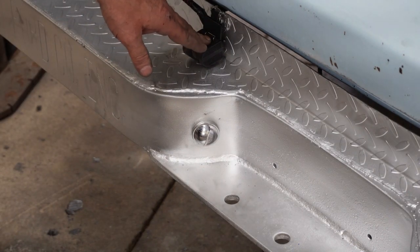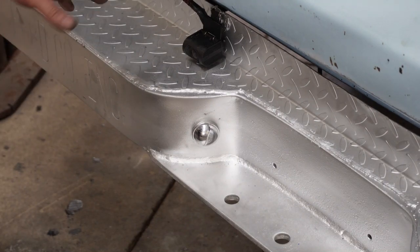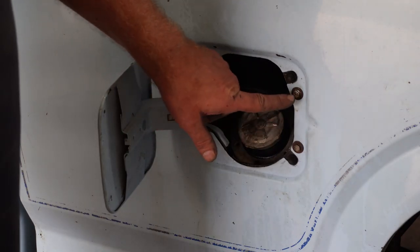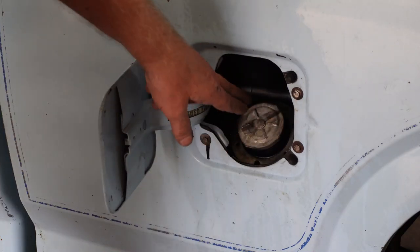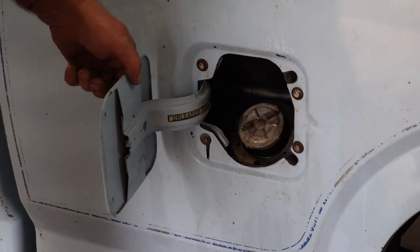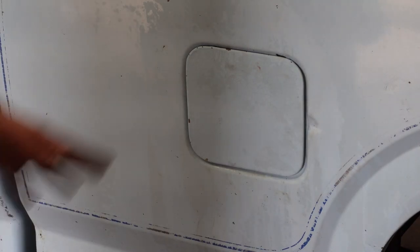The camera is part of a smart mirror I bought — it has a backup camera, front camera, all kinds of things in the mirror, though I only use the camera part. Comes in handy once you get used to it. I also got this fuel filler door all hooked back up — it's fairly easy. There are two screws here; when you take those out, the door comes off and the whole works drops down. But before you drop it down, there are three screws inside and one clamp bracket underneath that you have to take out, then it drops right out. If you just study it before you start, you save yourself some time.